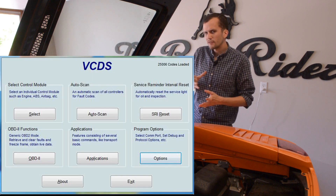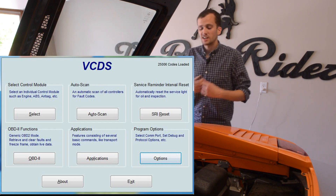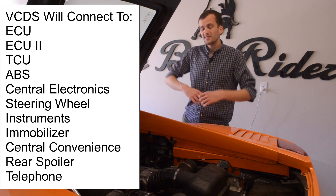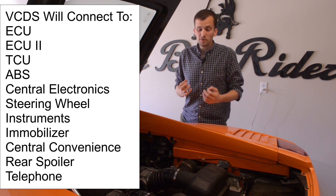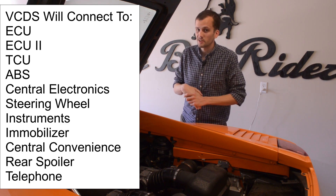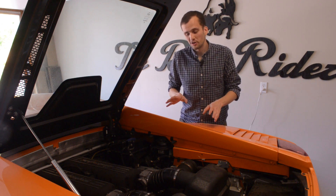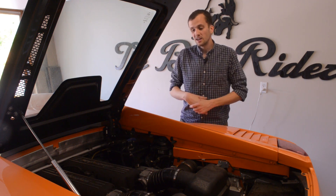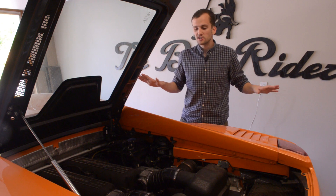VCDS is a little bit of an archaic platform — the user interface is older, not that intuitive, and you need to do a lot of research to connect to many of the control modules in the car. The amount of control modules you can connect to is also limited. That said, the Audi R8 and the LP Lamborghini Gallardo share so many components that, although it's not officially supported by VCDS, you can still connect to all these control modules and successfully diagnose and perform adaptations. Just like the pre-LP, the LP Gallardo is also fully supported by Texas Supercar at the same price, covering all scanning functions you'd ever need.